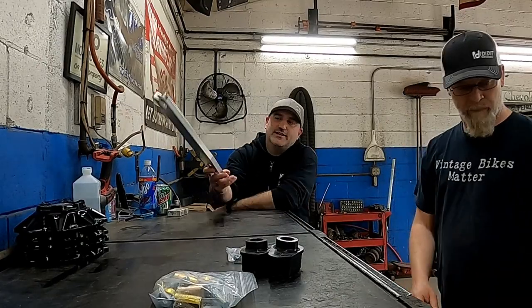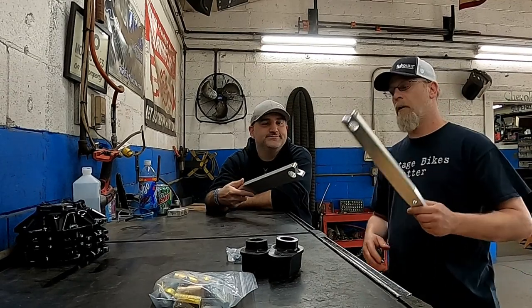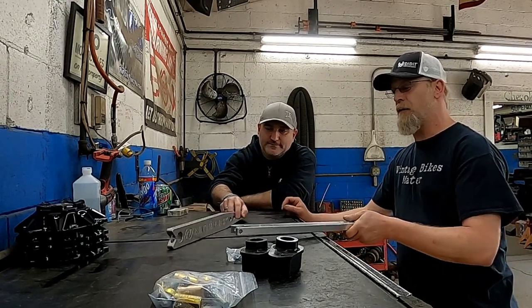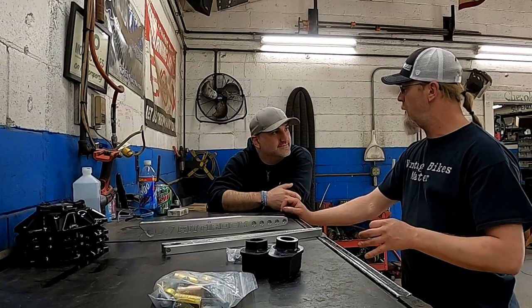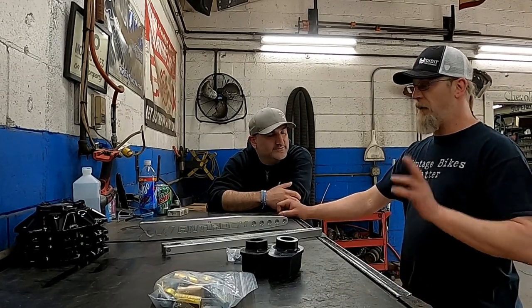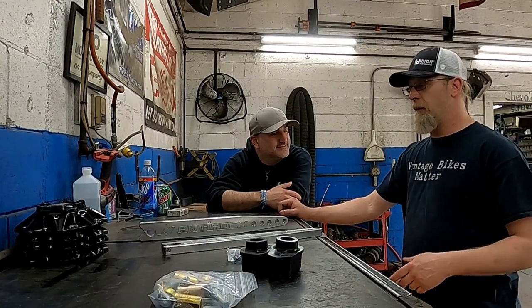What's the difference between all these kits? Is it really just the length of stuff? No. So you can get steel arms, you can get the alloy arms. There's your two options for the rear. In the front, you can get steel arms, alloy arms, and there's like three or four different bar diameters, which can give you different, basically a spring rate. They have a stock style replacement. They have more like, I don't even remember, don't quote me, but there was like the next step up.